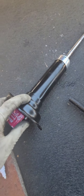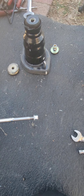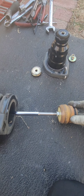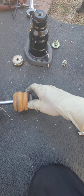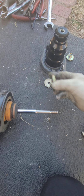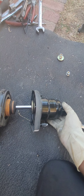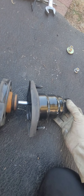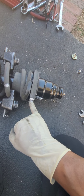You can guide the top part of the strut shaft so it aligns together — there we go, it's lined up. Then put this back on right here. Here's the new nut, which is nice to have. Always good to use the new nut. Press it all the way down, then this piece goes first, then the mount goes on.